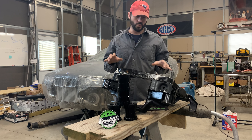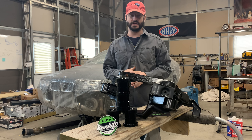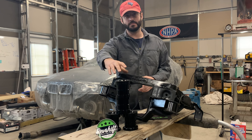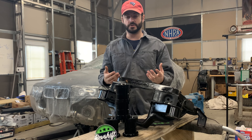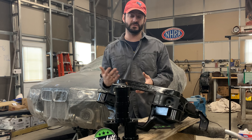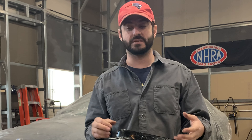Now that the subframe is all welded, reinforced, and painted, next I need to do the subframe bushings. I got them from RevShift — I'll put a link in the description. These are not super hard bushings; they're one of the softest ones RevShift offers, softer than some others out there. I did this for two reasons: even though they're polyurethane and the softest option, they're still stiffer than the originals. I want the car to flex a little bit in the back when I'm launching it, and I still want decent ride quality because it's still a street car — not a track car. These bushings should do great.